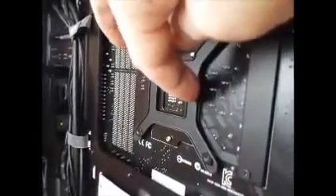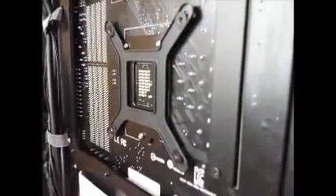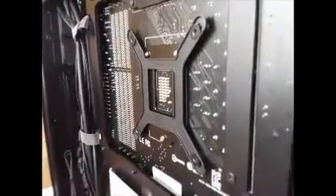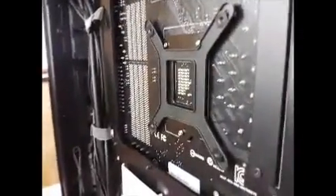The pump's back on and it's properly aligned — properly flush — and as you can see it doesn't wobble about; you can move the whole case by it. The back plate doesn't wobble either, because it's been pulled up from all four corners to meet with the pump. That's the Corsair H60, and that is why people are probably having trouble with it — because this isn't lined up properly. Hope that helps anybody trying to do this.